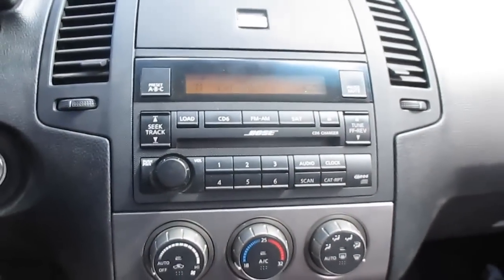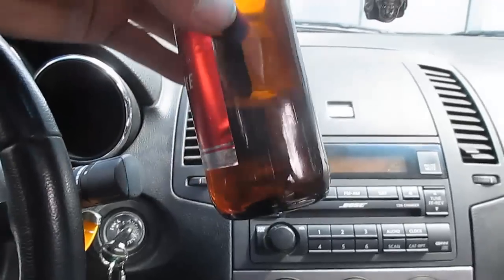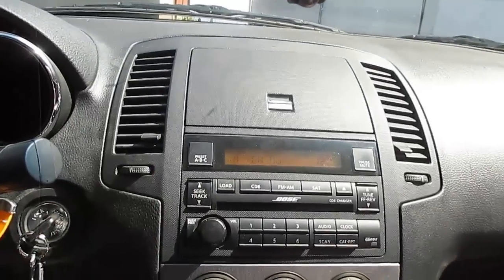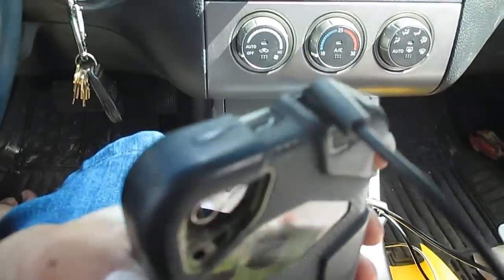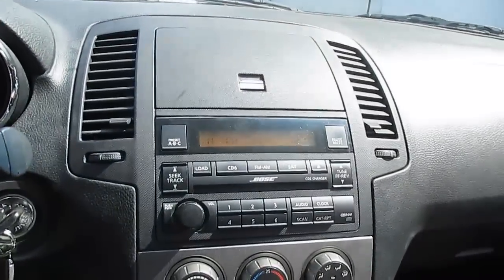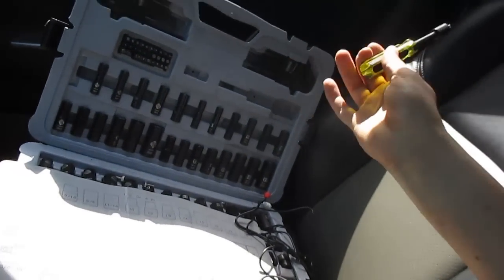Everything sounds clean, no static whatsoever. And we're just under a half a beer - so that's quick, about half an hour. The one snag I ran into was that one wire didn't fit into the casing, so I just had to trim a little bit of the rubber off so it fit in - no problem. All in all, it's a really nice and easy mod for a hundred bucks. Do it yourself in half an hour - it is doable. All you need is a screwdriver, that's it. Now I can bump my music through the aux.